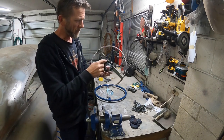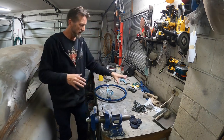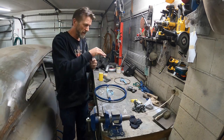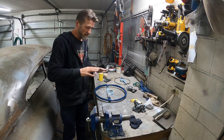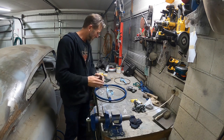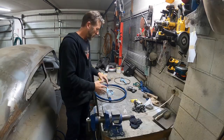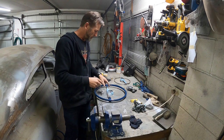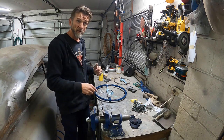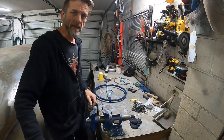Alrighty, ooh, little spiders in there, I wonder if they're from America. Don't know. So I've sanded all that back with just some 80 grit, all those repair bits, more to flush them down and give them a bit of a key to stick to, so hopefully that works. So I'm going to mix up a little bit of Bondo, bog, smooth, whatever, and give those a little smear, and I'll do those bits on the old radio buttons on the dash as well. So I need to clear some of this stuff away and get into that.